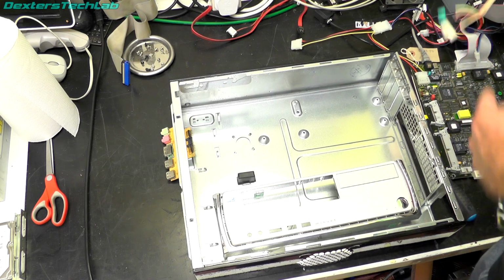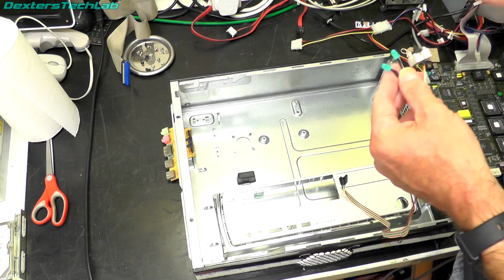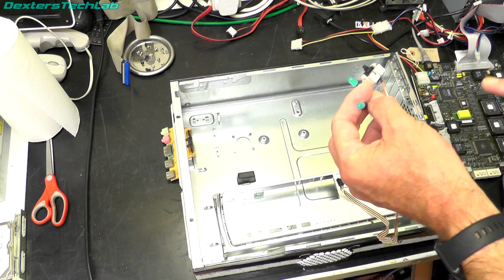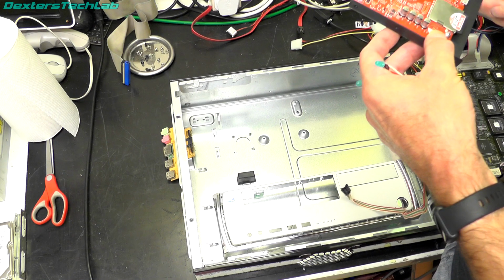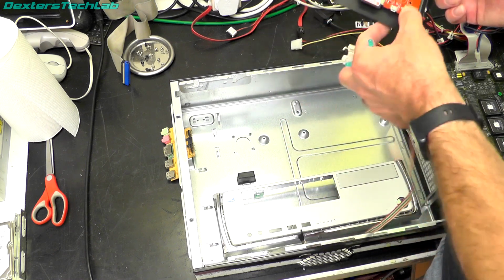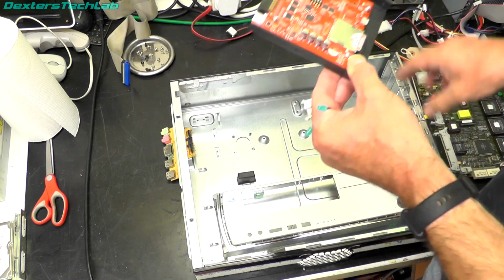The power switch and LEDs will be going back in. Obviously the power LED I'm going to have to try and rig in somewhere, and the hard disk activity light, it would be nice to have that working. I would suspect I should be able to connect up to the activity LED point on the Zulu SCSI, so that should be pretty good for that. So I probably just need to install a header on there that I can connect the normal wires into.